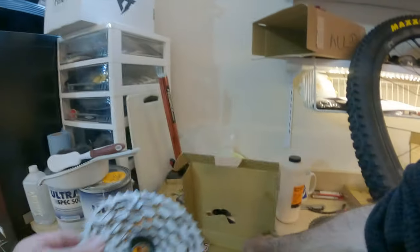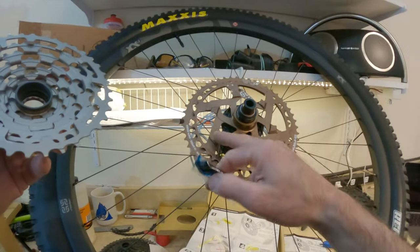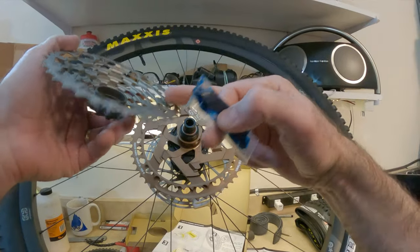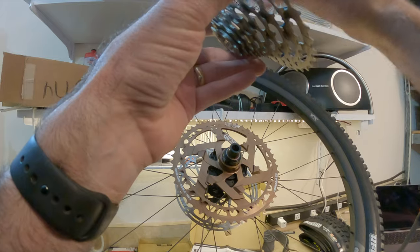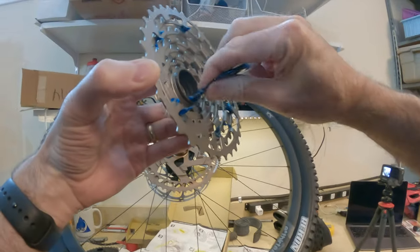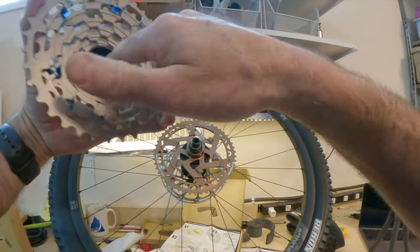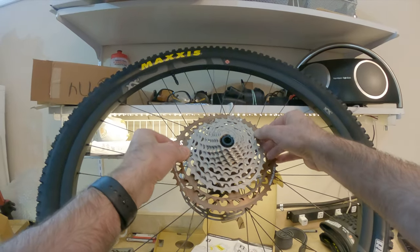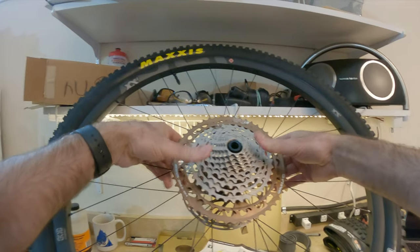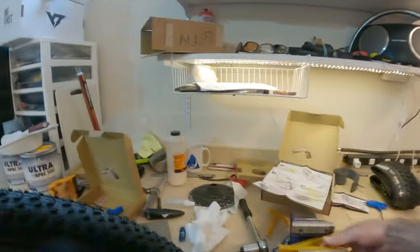What we have to do is grease the inside of this plastic bushing, and it also says to grease these connection points where this interface sits in — one, two, three. This is not the easiest thing; I can see this is going to pick up dirt. Then give that a real good smearing of grease on the inside. And then we push this on — that needs a really good firm push to get it down.